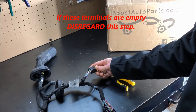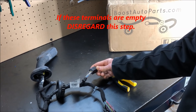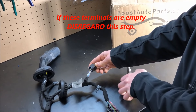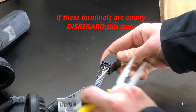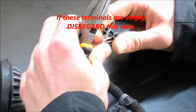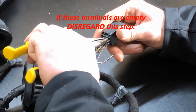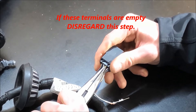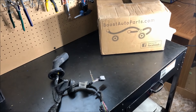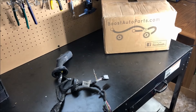If you do already have pins in terminals one or two, you'll need to remove those. With the white lock already unlocked, grab a pair of needle nose pliers and pull out — the wires will come out, they will be snug. After removing those two terminals, cut the metal ends off and tape them up out of the way, ensuring they will never short to anything.